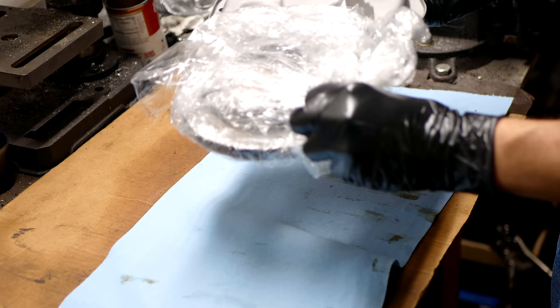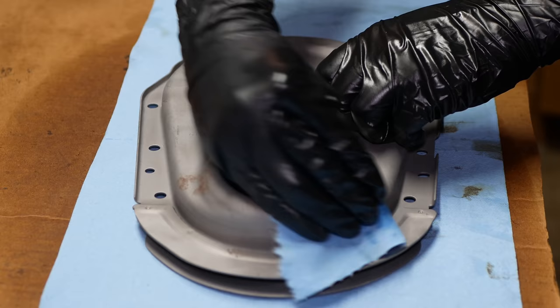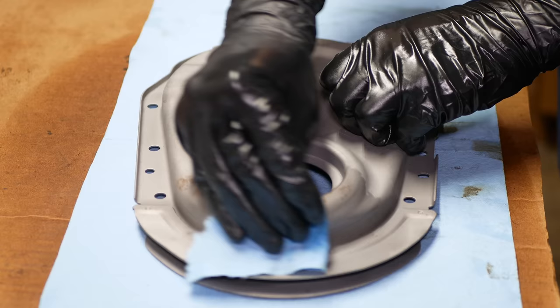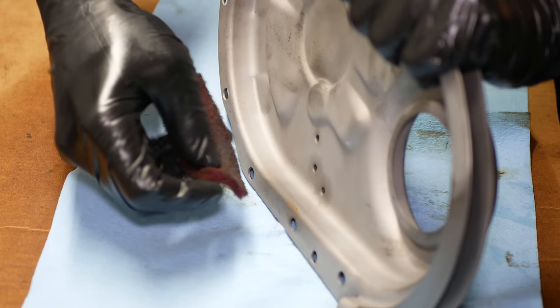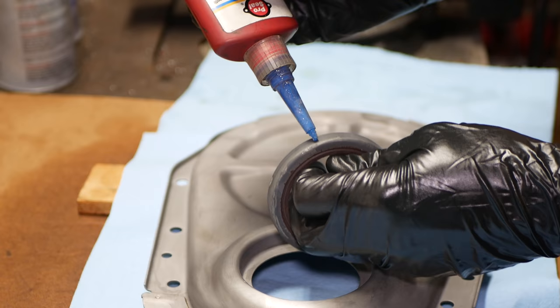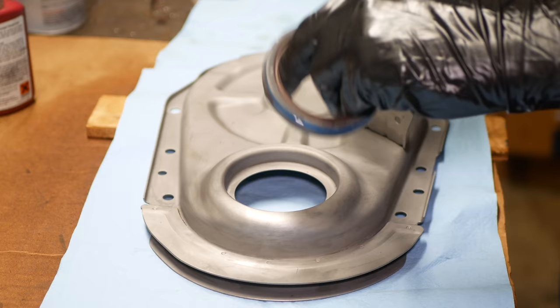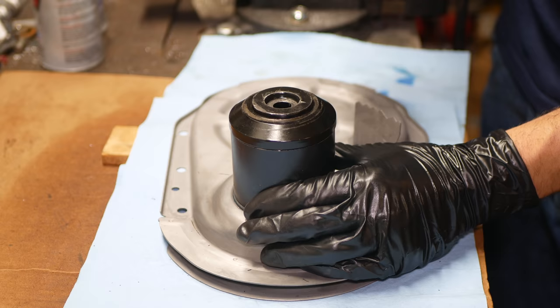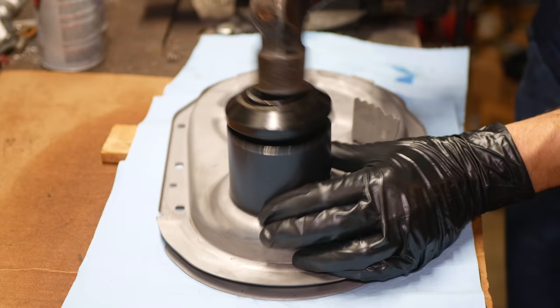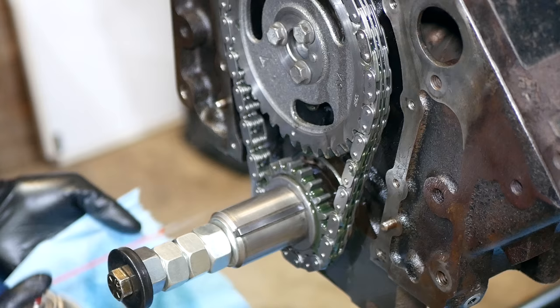It's time to get back out the timing cover. This is the one we modified a bit and sandblasted — it didn't get a coat of paint since I had planned to paint the engine once assembled, and I was hoping it would be okay sitting around as plain steel since it would make the paint prep later easier. But obviously that wasn't the case, since sandblasting and washing it there are a few very light spots of rust that have formed. We'll grab the red Scotch-Brite and it only takes a few seconds of scrubbing to knock the rust down. After spraying and wiping down the cover to make sure there's no residue left, it's time to install the front seal. This is the new seal included with the engine rebuild kit, and just for a tiny bit of extra security we'll apply some blue Loctite to the outer diameter. Then we'll drop it into place on the timing cover and use a piece from the ball joint press kit to knock it into place, making sure to hammer evenly around the seal so that it goes in straight.